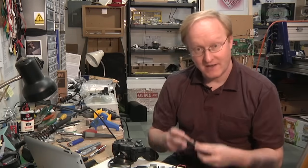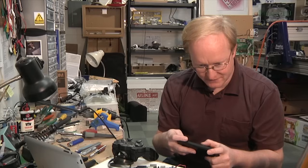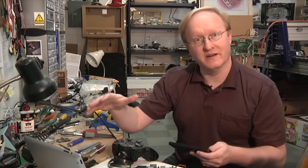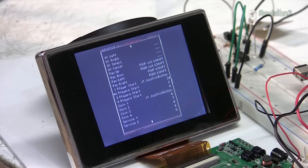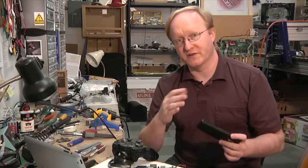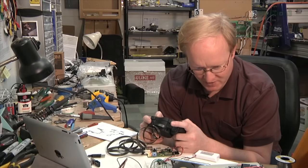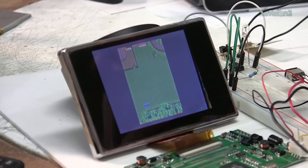I have my little keyboard here, but the idea is the final unit won't have a keyboard normally, so some of the stuff we need to set. Config menu — right now it's the tab button. I can hit enter and assign it to a joystick button as well. I also had to make sure that the player controls are hooked up to this joystick. One-player start will be joystick button start or number one. Coin insert is either the select button or number five. I'm going through this list to make sure all critical UI controls are mapped to the joystick, not just the keyboard. The joystick is working — I can pause the game, go to the menu, and jump to a different game, all with the joystick buttons.